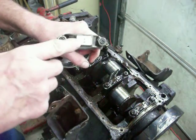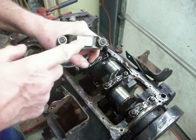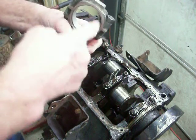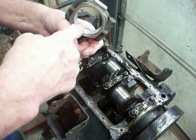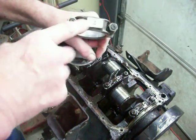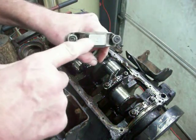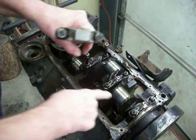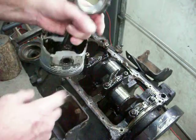You're working with very close tolerances here — like one ten-thousandths of an inch — when it comes to the difference between this cap and the journal of the crankshaft. So what I do is take an engraver and put a mark on there. This is the number one piston, meaning it's in the number one place on the crankshaft.